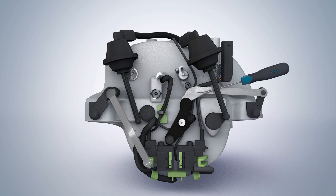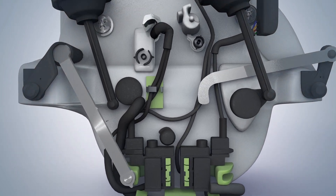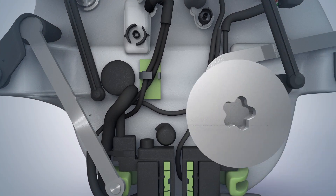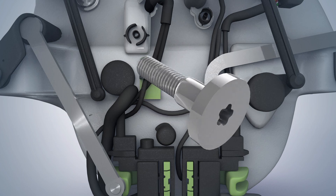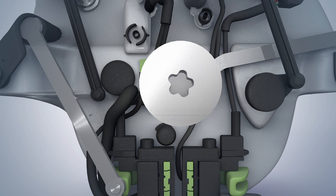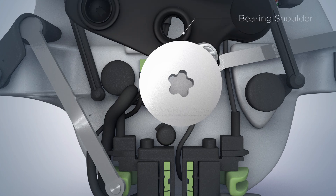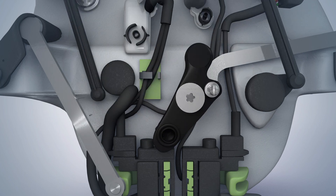Next, use the flat-bladed tool to remove the left and right metal flap connecting levers from the central pivot lever. The pivot lever is now accessible. To remove the central bolt, use a T30 Torx bit. We provide a new pivot bolt as these tend to strip easily upon removal. Install the Europremium aluminum central pivot lever using the newly provided pivot bolt, noting the correct orientation. Apply a small amount of silicone grease on the bearing shoulder of the central pivot bolt and blue medium-strength thread locker on the mounting threads. Tighten the central pivot bolt to seven to eight foot-pounds.